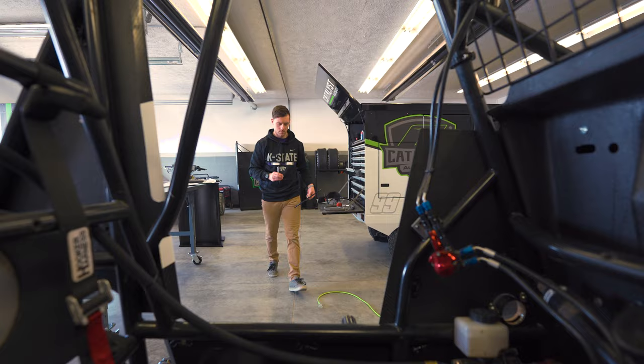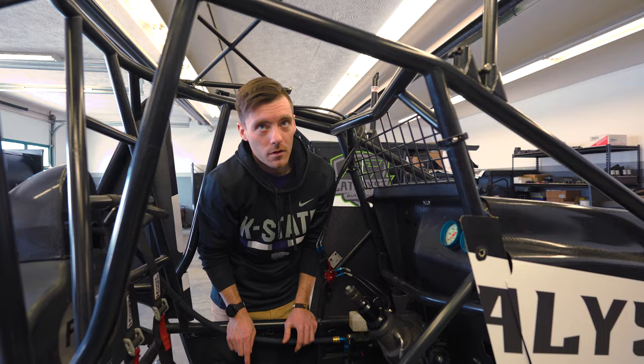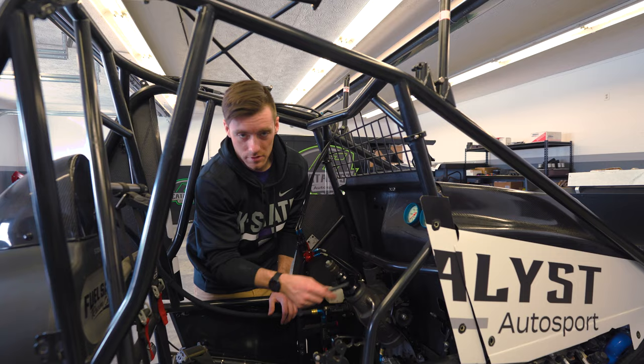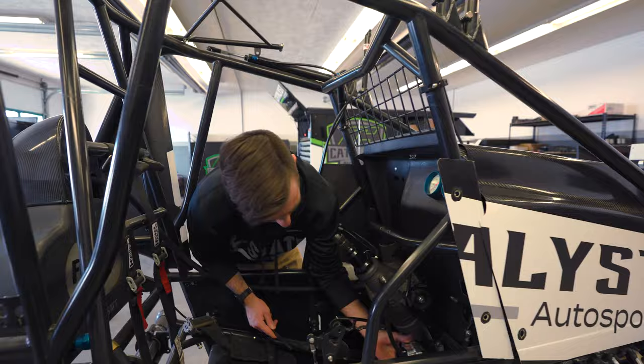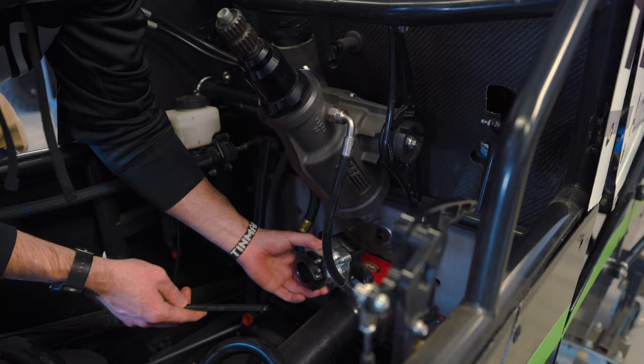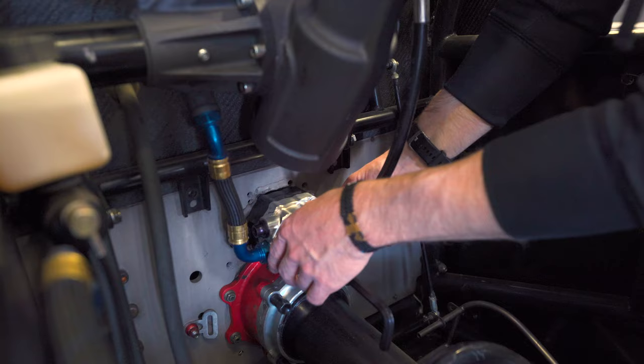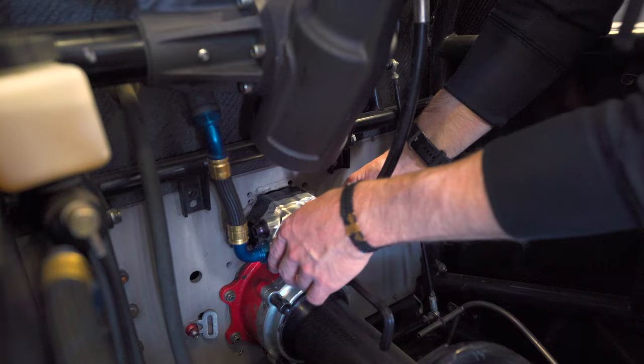Okay, looks all right, doesn't it? All right guys, we got our steering gear settled back in there — it's loosely bolted in because we'll have to move it a little bit. Now we got our power steering pump down here. That's the little cam spud that's actually on the back of the camshaft, and that's what spins this. Then the fuel pump sits out here, so we've got to get this back on here — I might have to turn that spud just a little bit. There we go.